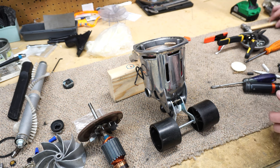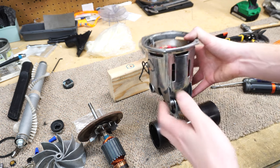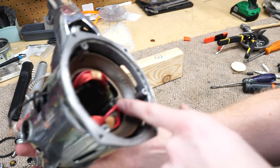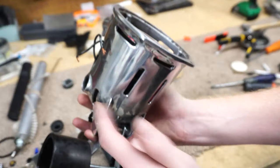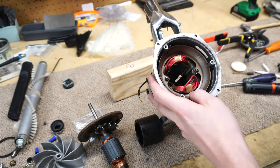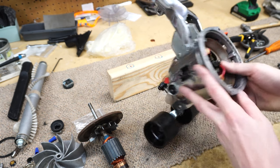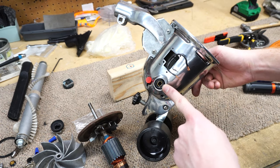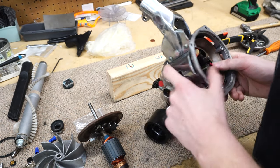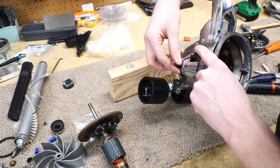The first thing I did was I lost two of the spacers around the field. I'm only human — I lost those two spacers that go right here, and there's two more to go below. I thought, oh, there's only two. I looked all over my shop, I cannot find them. Upon doing that, what I did was I crushed the carbon brush holders, which was a big no-no, because then the carbon brushes wouldn't move freely.